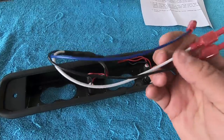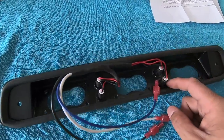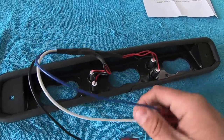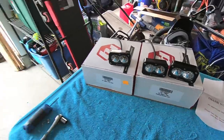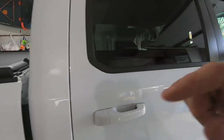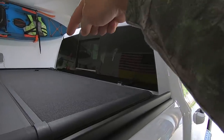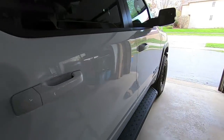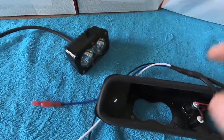The bracket comes pre-wired for brake and reverse lights — a white and blue wire for brake and reverse, and a black wire for ground. We'll tap into a ground from the factory harness and wire up to the factory feed. That's part one of the wiring. Part two is running wires for the S2 lights all the way up to my Trigger Four Plus brain sitting in the engine compartment — a positive and negative from the light, down the C-pillar, along the floor, through the firewall, and into the Trigger Four controller.